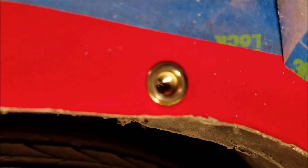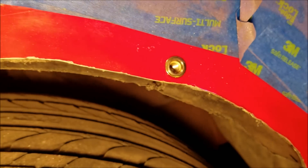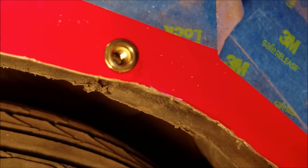We're clamped down on the smooth portion of the rivet. What we're going to do is turn the hex — the knurled portion is actually going to start to crunch in, and that's what's going to hold the rivet in place. As you can see, the knurled portion of the rivet is now crunched down into place after tightening. You really want to be careful not to strip your threads — that can be really easy to do. Once it's smashed, it's smashed. Don't go crazy with it or you'll strip the threads out and have a really hard time getting it out without ruining your fender.